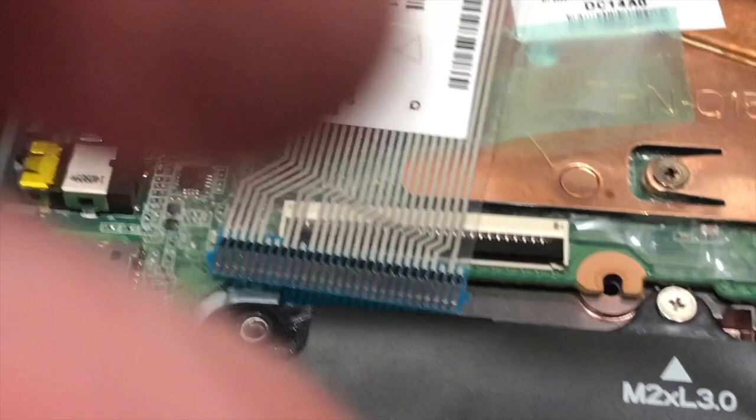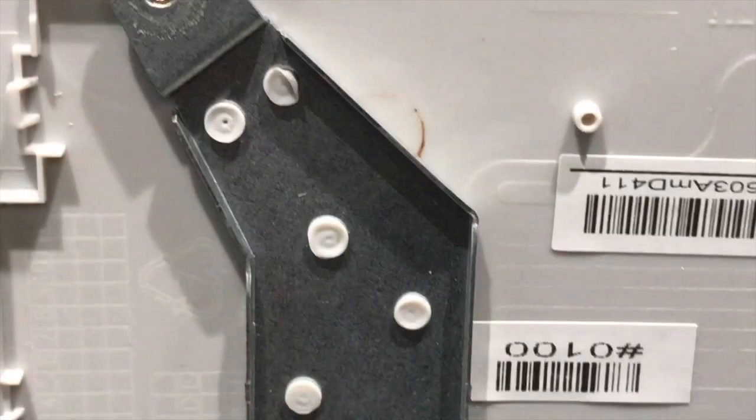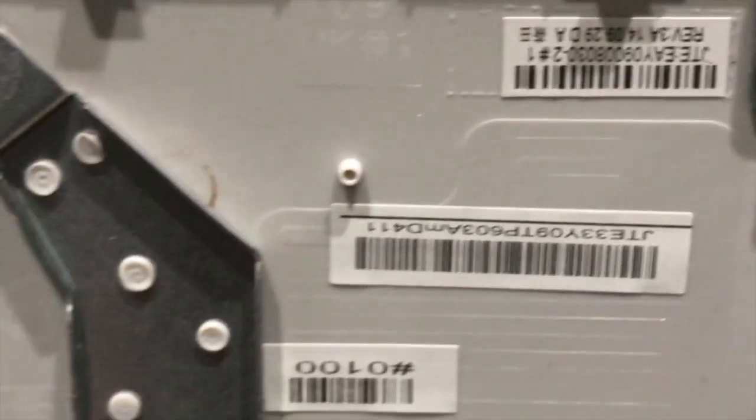Normally the keyboard cable is detachable at both ends. Unlike other keyboards, on this Chromebook the actual ribbon cable for the keyboard disappears inside the machine. The keyboard section is actually fastened on by melting plastic from the keyboard into the machine. So unless you want to snap off all of these pieces of plastic — and there are hundreds of them — fixing the cable is a bit of a problem.